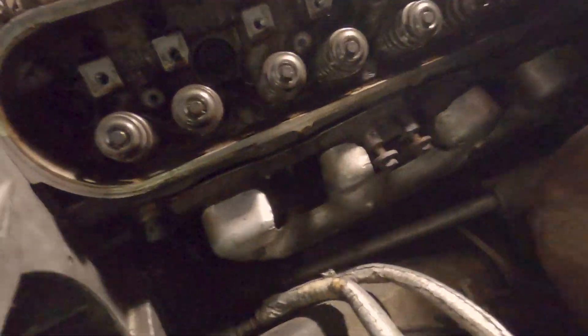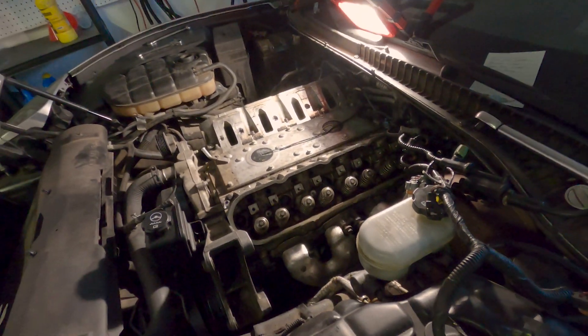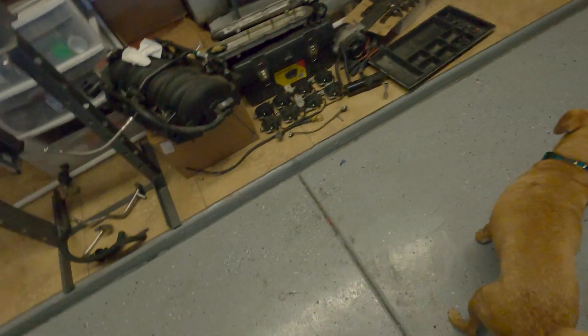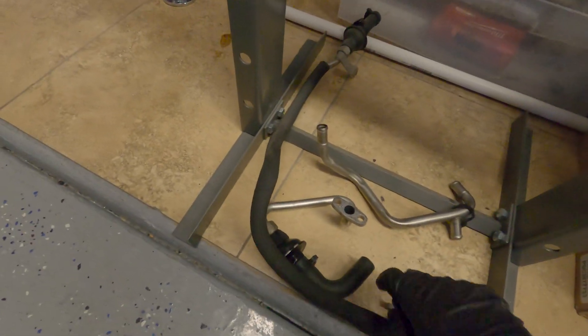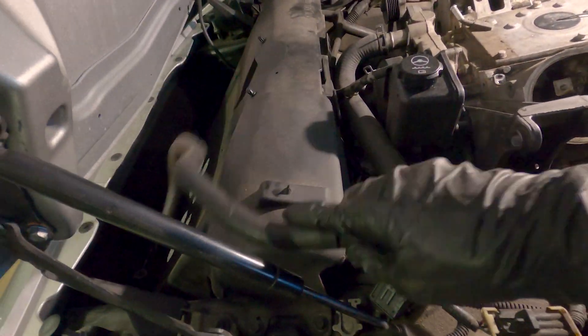I also want to get rid of the EGR, and obviously aftermarket headers are not going to support EGR. So there's a lot of stuff to clear up — engine bay, these hard pipes that go everywhere, and then there's a line that actually runs into the front of the car. So I can get rid of all that.